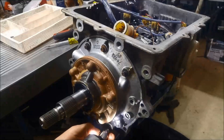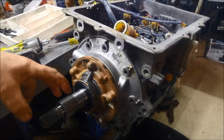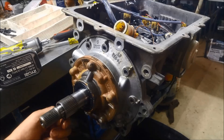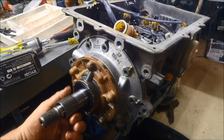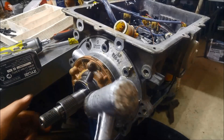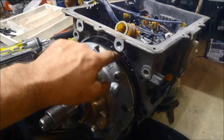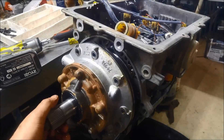All the pump bolts are 8mm. To get the pump off, there is a tool that pushes in and pries it out, but if you support the bottom end of the stator shaft — the wider shaft — and use a pulling action with your hand plus a soft hammer and give it a tap, it'll dislodge. There's an O-ring that holds it and sometimes the gasket gets stuck on there, but quite often it'll just come out easily.